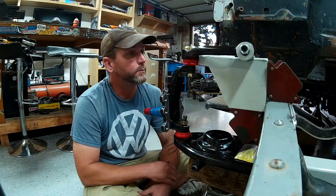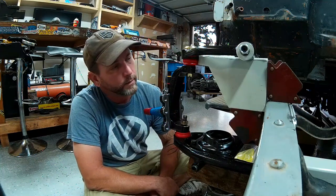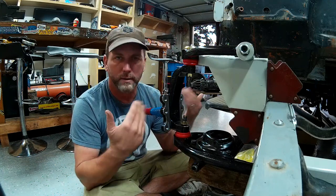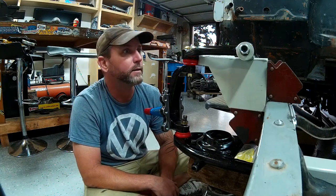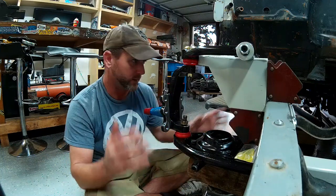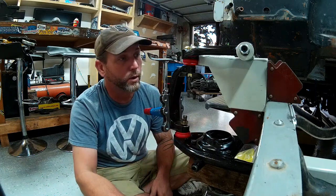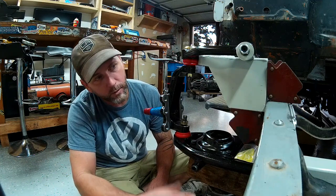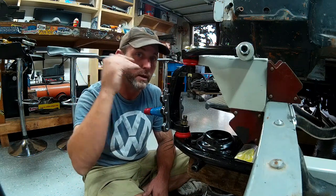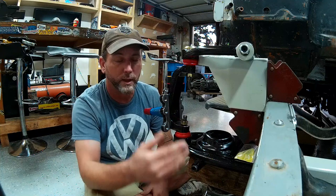I'm going to leave it off like this for tonight. I've basically got to locate the upper control arm mounts and coil buckets, and they need to be in the proper position to locate the spindle where we want it. Right now it's obviously not perpendicular to the horizon. I was just trying to get an idea of where the upper spring bucket needs to intersect the frame so I can plan how much I need to notch out of it. I know it needs to sit in quite a bit more, and the upper arm angle needs to be on a downward slope slightly so that my instant center is in the correct position relative to the pivot points.